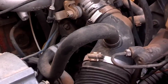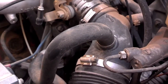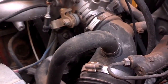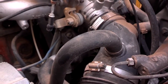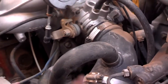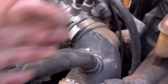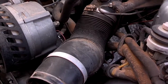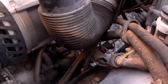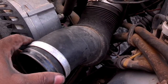I'm taking these air intake tubes off. I used to do this every 5,000 miles with my other 740. You can get away with waiting every 10,000, but I did learn that my throttle would try to gum up every 5,000. Take these clamps loose and take this throttle body intake tube off and this intake tube off. Anytime I had idling or starting issues with my other 740, I normally took this tube off and found a hole on the underside of it. You've got to make sure you check this tube every 10,000 miles to make sure it doesn't have any holes in it.